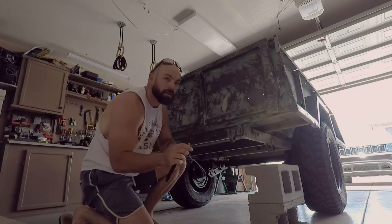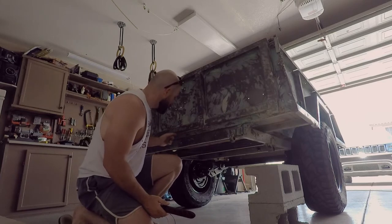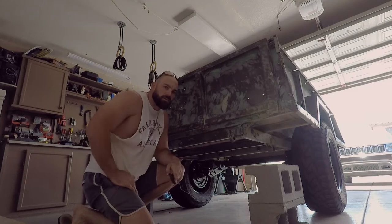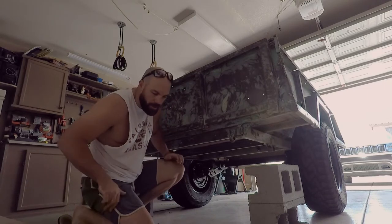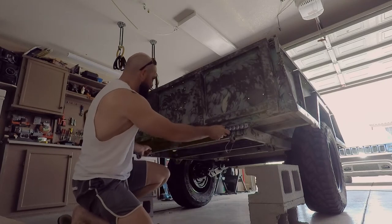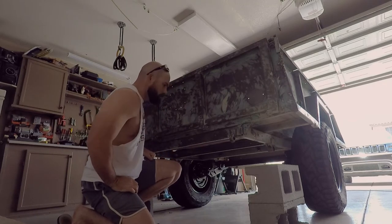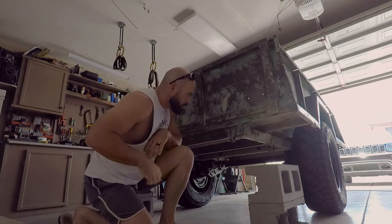The other dilemma is that the frame is kind of recessed behind the tailgate, so the light may not reach. I think instead I'm going to mount it in the tailgate itself, and have a light on each one shining toward the license plate. The issue then is getting the wiring back down underneath and back up to be powered. I think I'm going to wire it all to a common center here, then back into the frame and out. I looked at the tailgate and there's enough play — it comes outward and there's no binding situation — so I can have a small loop of wire here, and as long as it's in a protected sheath it should be fine. I'm also planning to add more lights as we go, and I may wire some to a switch for camp lighting.